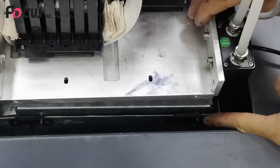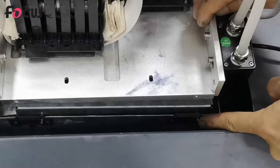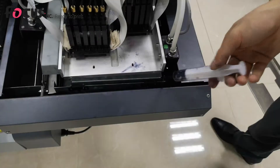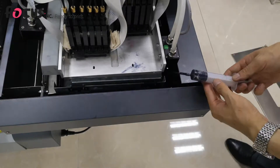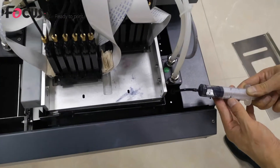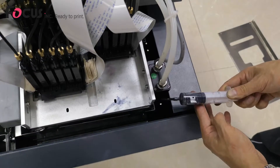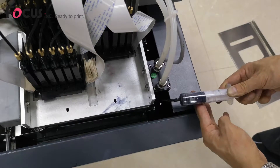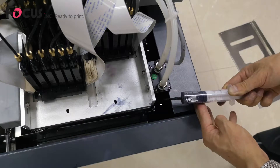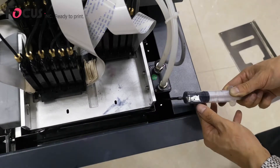Pull to the top like this, then load the injection to pull the ink out from the color print head from the ink damper. Important: we cannot release the injection immediately. We must wait for the injection to release pressure automatically. If we release our finger immediately, the waste ink will flash back to the print head and cause the print head to print mixed colors.